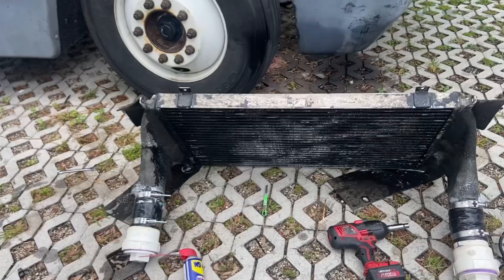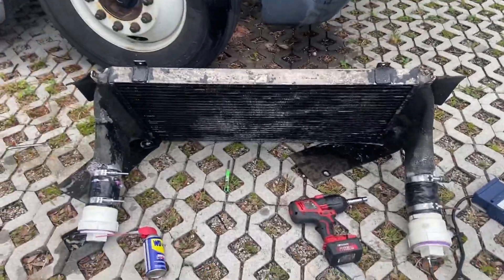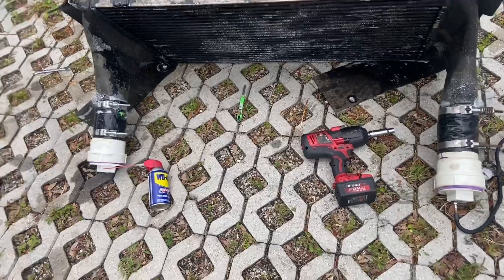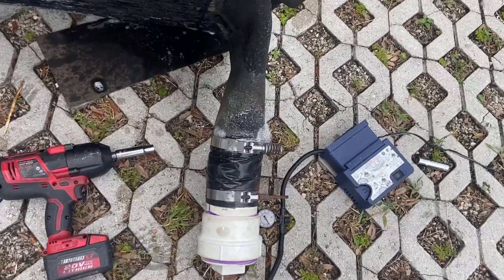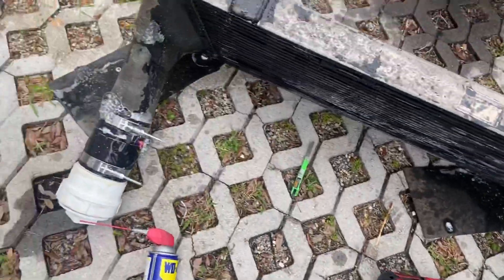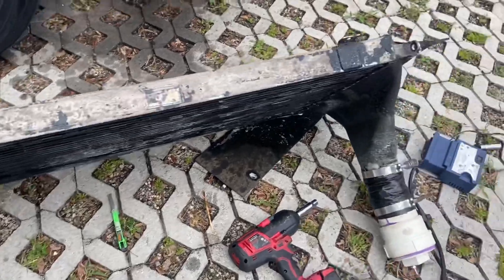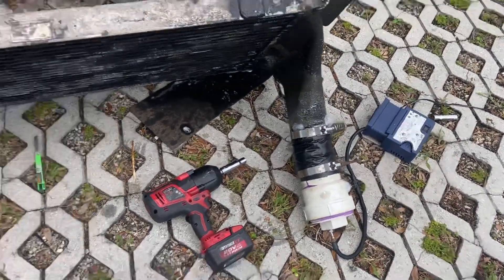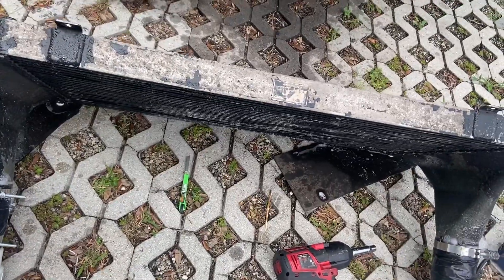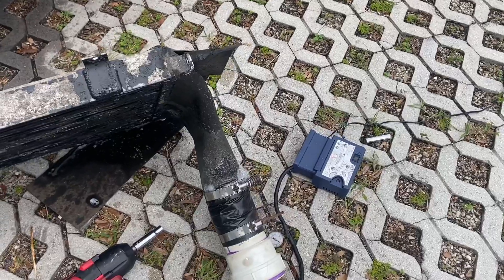Come to the conclusion: the core and the side tanks are good. But from all the corrosion here on the outlets, that's what's leaking. It's not actually leaking through the couplers I made — it's actually leaking on the outside between where the paint is peeling. So I'm gonna have to clear all that off.